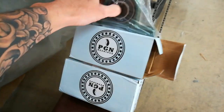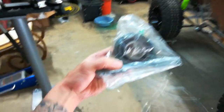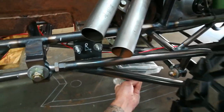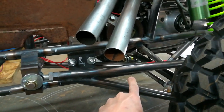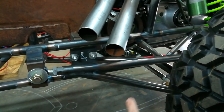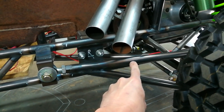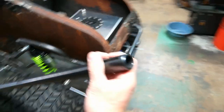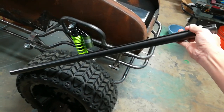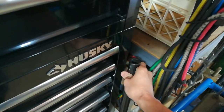I also got these one-and-a-quarter-inch pillow block bearings, which are going down on the frame rails directly under the drive sprocket. I'm going to have a jackshaft directly under that with a short chain from the engine sprocket, and then the jackshaft gets a second sprocket next to it, and that gets the long chain going all the way to the back axle. I also just ordered a short one-and-a-quarter-inch hollow axle that's going to serve as my jackshaft — that's what those pillow block bearings are for.